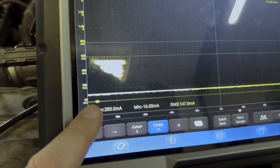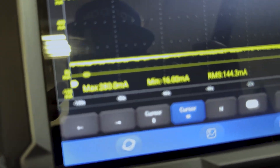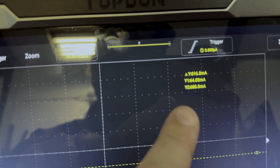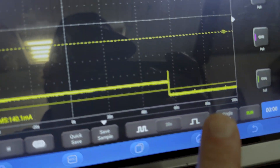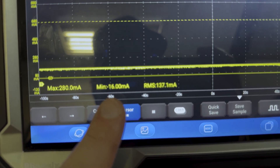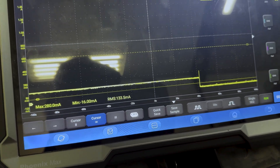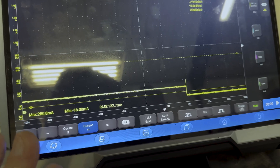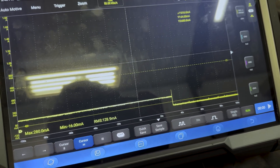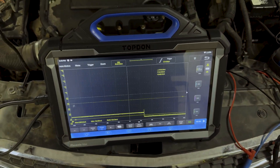You can see right here we set a threshold with our cursor, basically set to this value — Y1. We set the threshold for 64 milliamps, and you can see our draw has now fallen below 64 milliamps. If you look right here, our minimum is literally down to 16 milliamps. So we know the vehicle has gone fully to sleep and that there is no draw on the vehicle at this time. Now we could leave this sit for an extended period of time and then do the screen record function on the Max to see if at any point in time it wakes back up, just to make sure there's nothing on the vehicle that is falsely waking the car back up. But at this point we can see that the draw is completely gone.